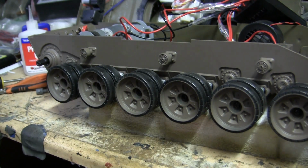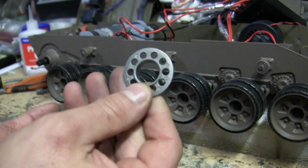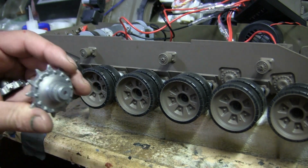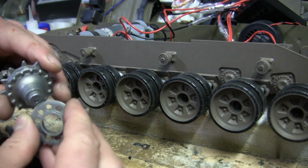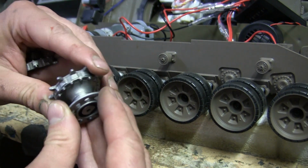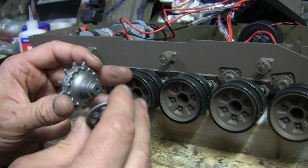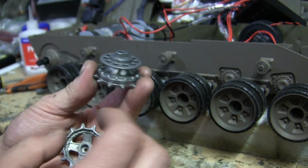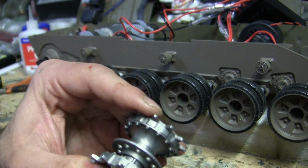So the sprockets are a three-piece assembly where we have the two tooth rings as well as a center guide tooth aligner, and basically they just fit together as such. Luckily, you cannot put this on in reverse with the way the component is shaped. There is a taper to it, and if you try to put it in reverse, it's just not going to fit in place. If you are trying to put this into this location here, fumbling with it, stop. Do not do any sort of modifications or hand fitting. All you gotta do is simply flip it around and the piece will seat properly like you just saw me do just now. On this component over here, you could just line up the two halves as such.